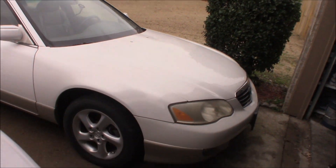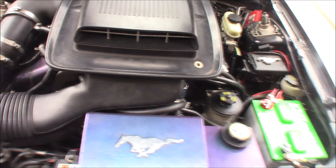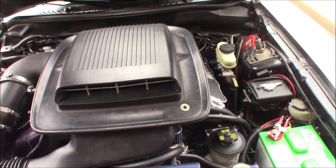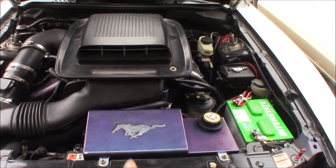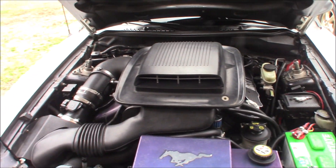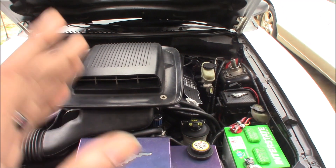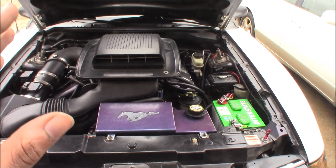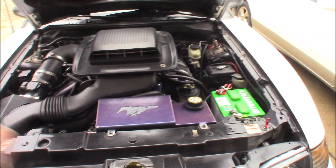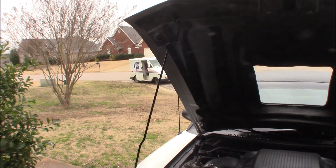As far as engines — with a 5.0, GT, and V6 — starting from a GT is a whole lot easier than starting from a V6 or 5.0. The V6 has a bunch of different, weaker parts. The 5.0 is basically the same platform as the V6, while the GT is the same platform as the four-valve, so you don't have to worry about much there.